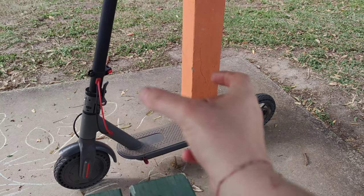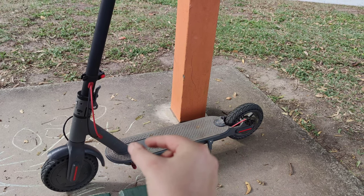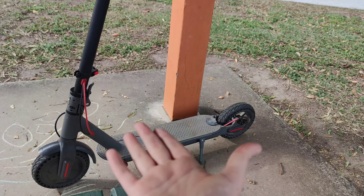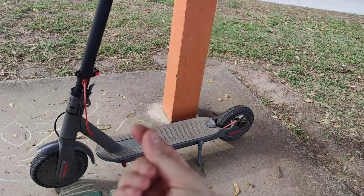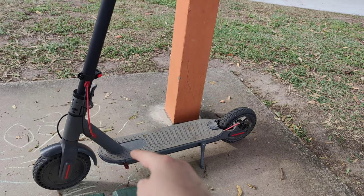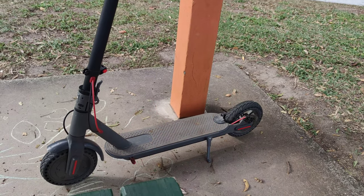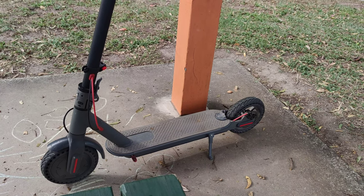The controller will get very hot. In this scooter, here is the battery, and right there affixed to the roof is where the control board is screwed up to. The control board is mounted in an aluminium case with thermal paste where it's screwed to the roof, so the scooter actually acts as a heatsink — that's useful for dissipating heat.